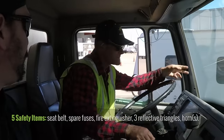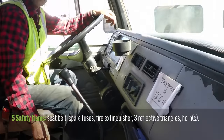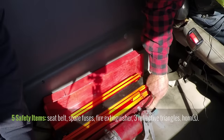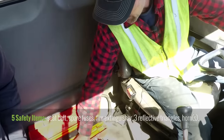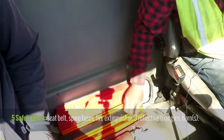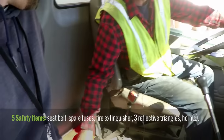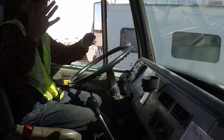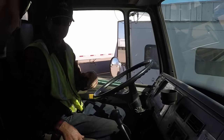Second, you're required to carry spare fuses. Third, your fire extinguisher — three things: it is fully charged and in the green, it is securely mounted, and by the logos it is the correct type ABC. Fourth, in the red box you need to tell me there are three color-red reflective triangles — not bent, broken, or cracked, safely stowed so they're not under your feet. Fifth, do your city horn and highway horn. That's five areas of safety, six items: seat belt, fuses, fire extinguisher, triangles, and horns.